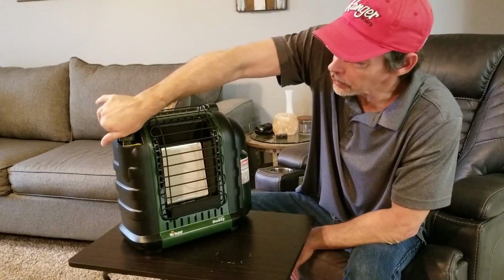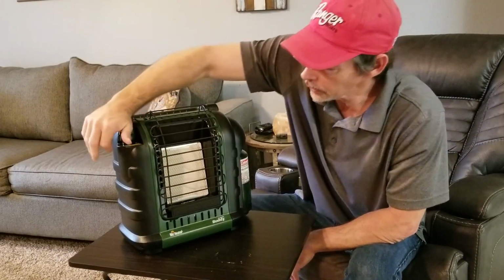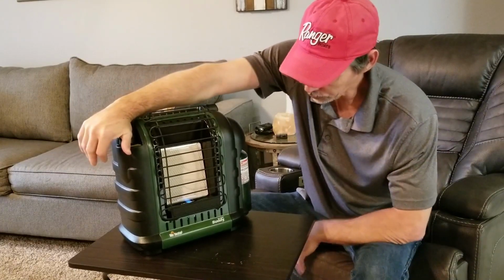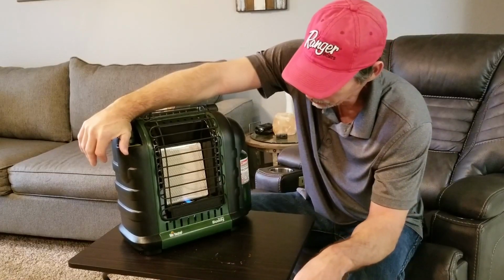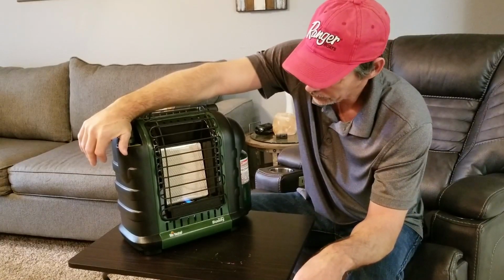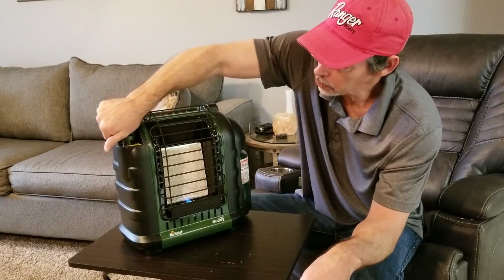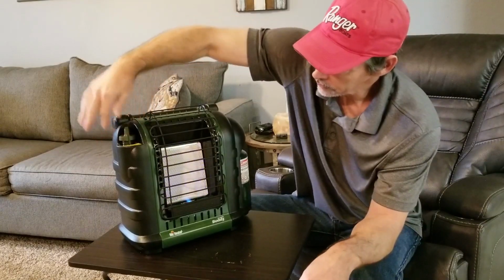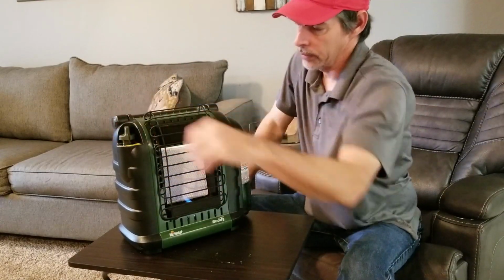You will push it down and go to pilot. Then you will push it down again. Hear it click. Hold it for a little bit. You can see the flame down there. I'll let it burn just for a second. It's going good. Let up. I believe you have to push it down a little bit to turn it to low. Alright, there's low.